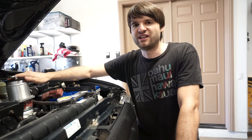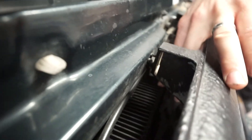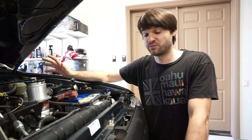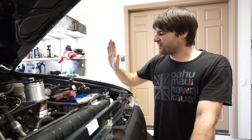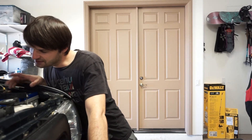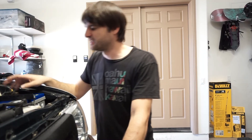We also installed a large power steering cooler in the front to keep the fluid cool during lots of trail turning. The steering box is a rebuilt PSC unit that's also tapped, and steering feel is actually pretty tight for a solid axle truck. The battery is an AGM X2 Power battery made in the same manufacturing plant as Odyssey — a great deep-cycle battery, Group 34 or 24F. We've used it on trips to run the fridge, truck off all night, and it restarts every morning no problem.